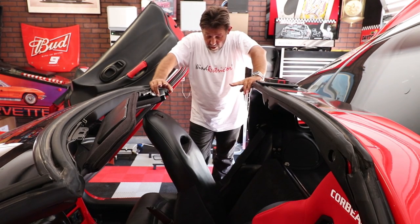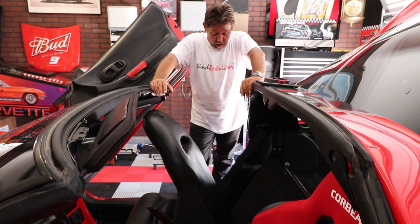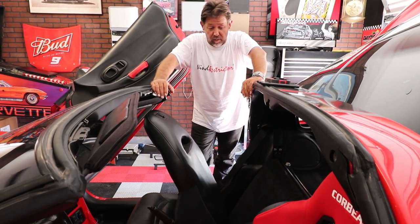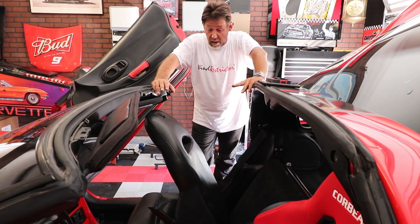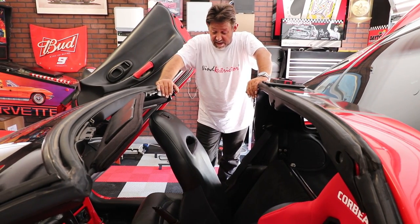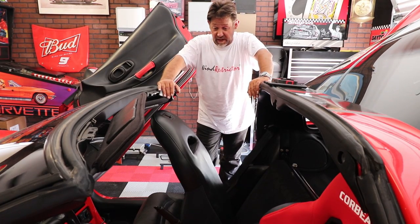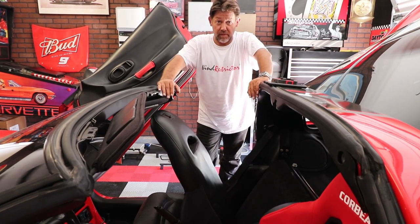Without the five-point harness you wouldn't need the bolt extenders, and without the bolt extenders you wouldn't need to enlarge the holes or anything like that. The only thing you may have to do is drill out the holes in the actual seat frame just a little bit — at most two holes — but that's it. It's because they're putting in the whole five-point harness and everything that we had to make all the modifications to the seat frames and the five-point harness rails, and that's why we had to put the bolt extenders in there. Dan's starting on the second side — the passenger side — and for the sake of filming, there's no difference between the two sides, so we're going to go ahead and time-lapse that portion and come back once we've got the new seat put in.